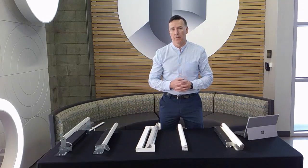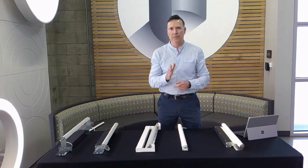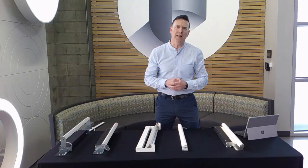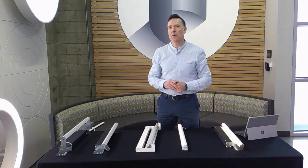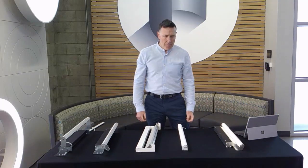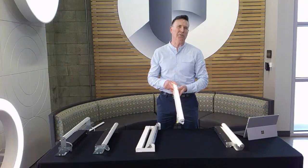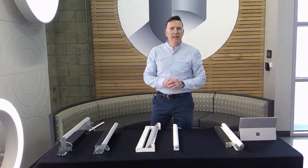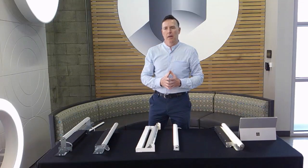To shrink this down to the scale we wanted, we now use three different optical components. The first is a TIR-style optic placed right on top of the chip — it captures everything coming out of the chip. The front half is directed toward the main beam aiming angle. The second half of the chip is captured and sent into a specular reflector, which grabs light from the back half of the chip and throws it into the main aiming angle. The third component is a secondary prismatic refractor, whose job is to clean up color striations and throw light above and behind the optic itself.